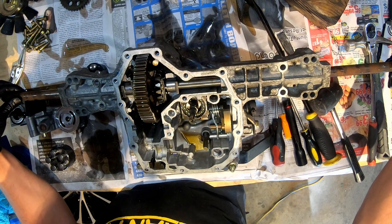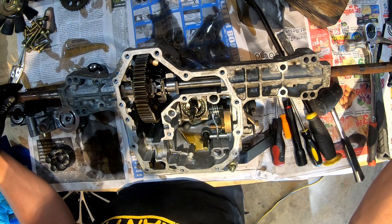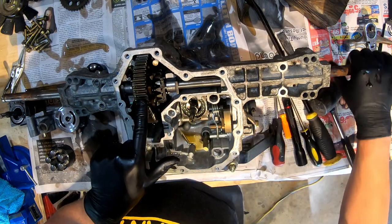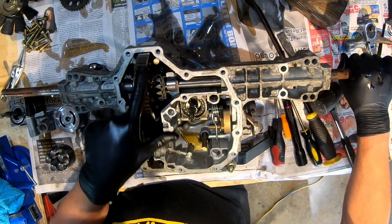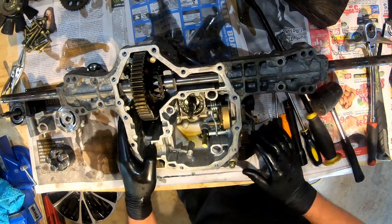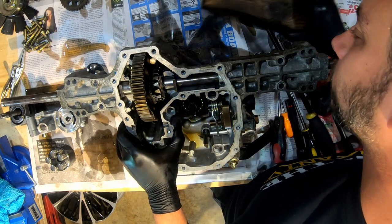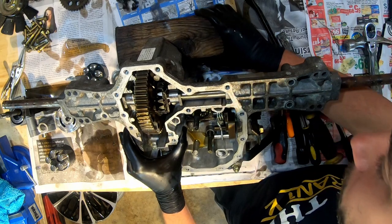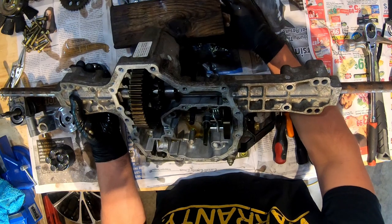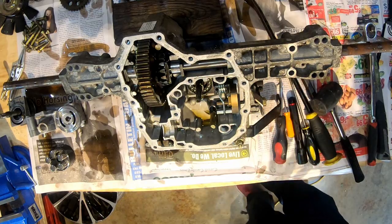That part's just like on a car or a truck. Got these little pins here, when you turn it like that. They'll turn both sides, but one can be held. It allows you to go around the turns. That spring is fatter on the one end than the other. It wouldn't go back together that way anyway if you put it in backwards. Okay, just getting a little ahead of myself here. Looks good.